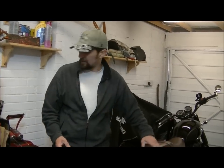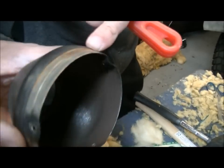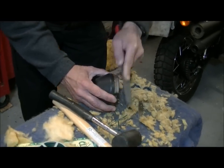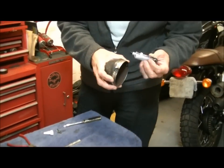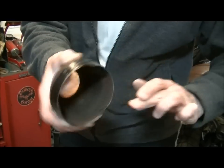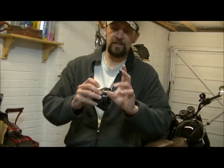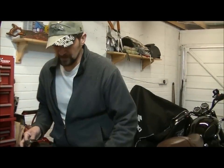I'm going to reassemble this now — stick the cone back on the back. Before I do that, that's what happens with condensation: you get rust around the ring. So I'm going to file that rust off so it fits back in nice and tight. I'll pop a little bit of silicone around that this time to get a nice seal. I'm putting the silicone on as much as a rust preventative as anything else — that condensation gets in that joint and rusts it solid. But the silicone will stick it in place with less grief than the rust, so when I need to get it back out to repack it, it'll come straight out by breaking the silicone seal.